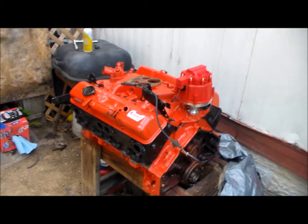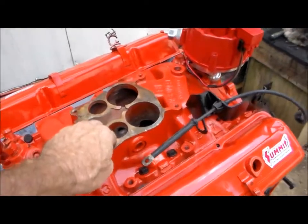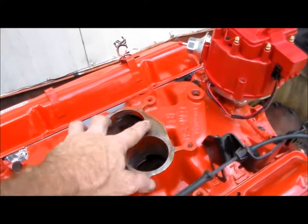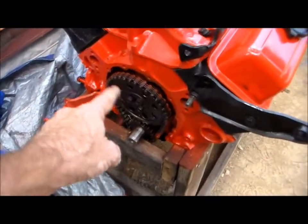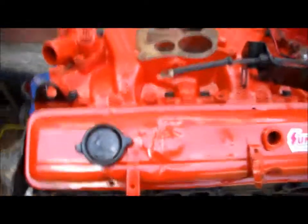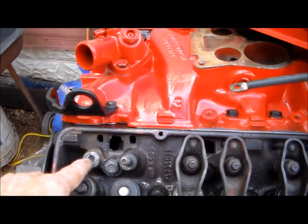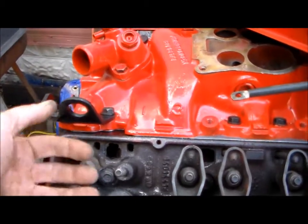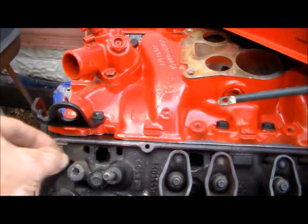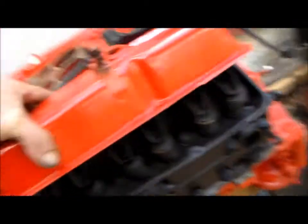Let me back up a little bit. I'm still working. I think this right here is going to have to be a four-barrel intake — well, it is a four-barrel intake, I just got to put a four-barrel on because I can't find a reducer. I still got to put a timing chain in. I got the water pump that comes on. One thing I got to do though is re-tap that — when I torqued it to spec, it pulled this piece right here out, so I got to replace that.